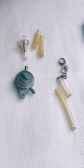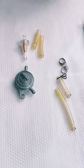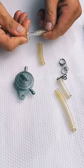In this video I'd like to show you how to build the GY6 150cc scooter fuel line. Right up here you have the fuel tank. You're going to have a little hose that is 3/16 hose that goes inside your fuel filter.